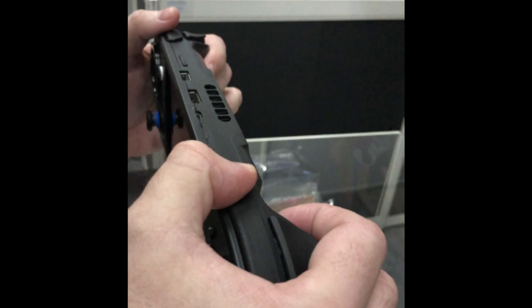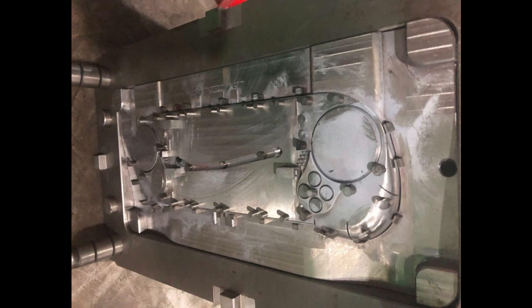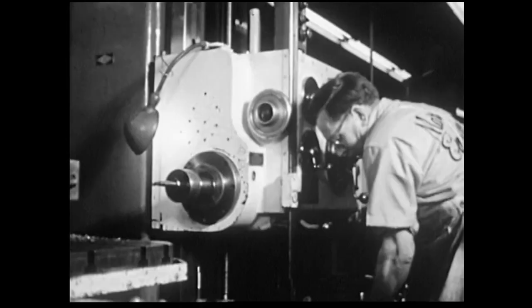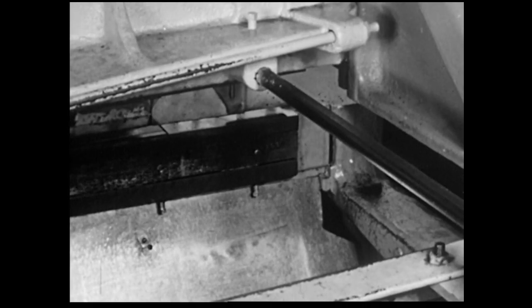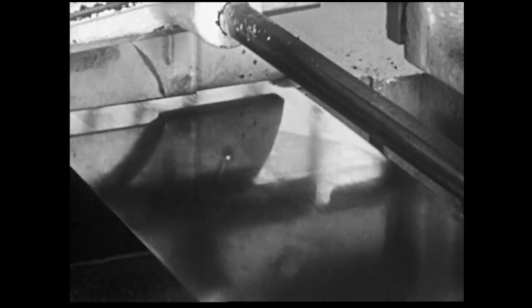Does that mean people are only able to change out the SD card by disassembling the whole thing? And that is not an easy problem to correct. You might be thinking, 'Oh well, no biggie — they'll just cut another hole in the mold and that'll fix it.' But no, that's not how it works. The mold is a negative of the plastic it produces, so if you take away more metal, you end up with more plastic on the case. The only way to fix the mold is to add metal and reshape it again, which is not at all easy. For something this small with a carefully detailed surface, it is likely impossible to fix the existing mold. The solution left is to throw it away and start all over again — and these molds cost tens of thousands of dollars to make.